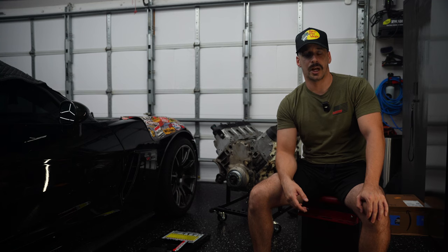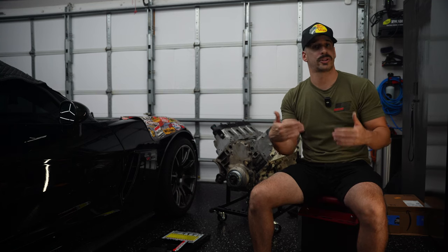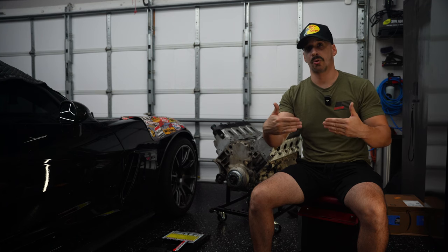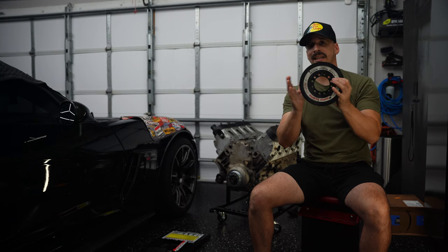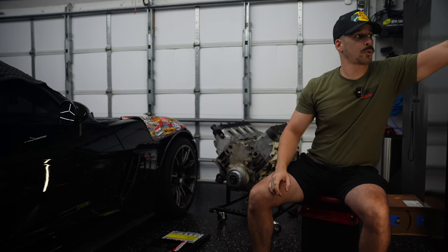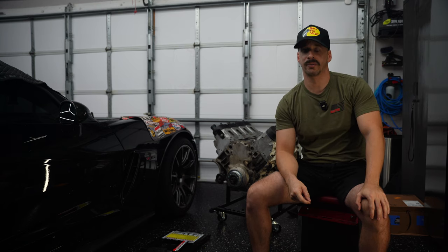We did lower the subframe and we actually did loosen the steering rack a little bit, but only just to give us about a quarter of an inch. We actually took the front off of the super damper to give us a bit more clearance, which we probably didn't need to do. But again, we probably didn't need to, because then we finally came to the revelation.